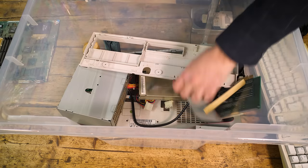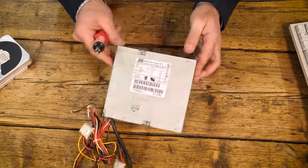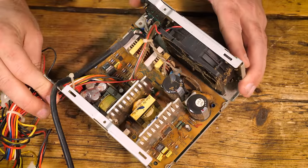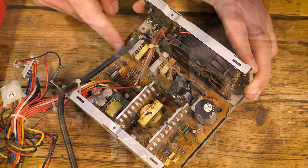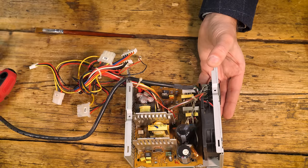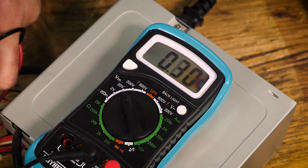Let's start with testing, and we're going to start with the PSU to make sure we don't put any unsafe voltages into the system. At 150 watts, it seems minuscule compared to the 1000 watts in my editing PC these days, and those fans have sucked in plenty of dirt in its lifetime. I popped the lid off to check for signs of leaks — no obviously bulging caps or damage around the base — so I gave it a brush and a blowout to tidy it up, then plugged it in for testing. On the meter I was getting happy readings on all connectors and nothing out of spec, even after leaving it on for 20 minutes or so. I'm confident it's not going to blow anything up.